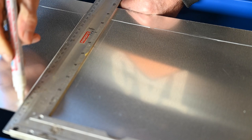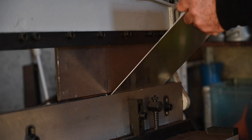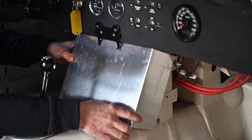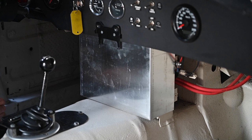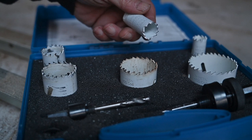Here's the first piece and I think that looks good. This is the panel that we're going to put up. We just bent it — let's see if we can fit this in. I think that is fitting quite nicely. Now I can actually drill the holes and put the handles in. To cut a hole in the aluminum where the emergency shutoff switch will come through, I'm going to use a hole saw specifically for metal. You install it on the insert, stick it on your drill, and then you can drill the hole through the panel.